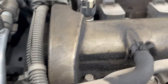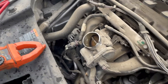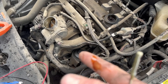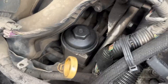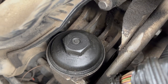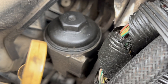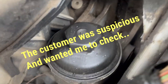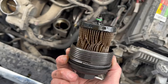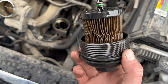It's leaking oil pretty good. She said she just had her oil changed. Looks fine. This was a quick lube type place - they said they changed the filter. I'd be curious to look in there. I mean, it's covered in oil and I don't see any scratch marks or recent signs of somebody being in there the last couple of days. Makes me a little hesitant to believe them. They said they changed this oil filter yesterday - I'd say they're lying. When you see them collapsing like this, they're typically old.